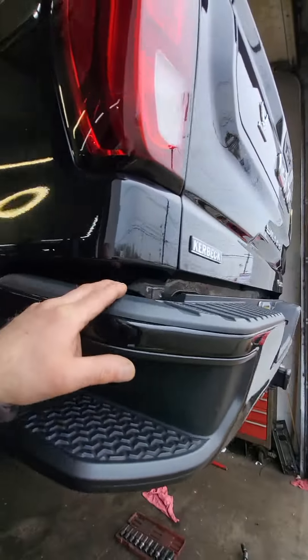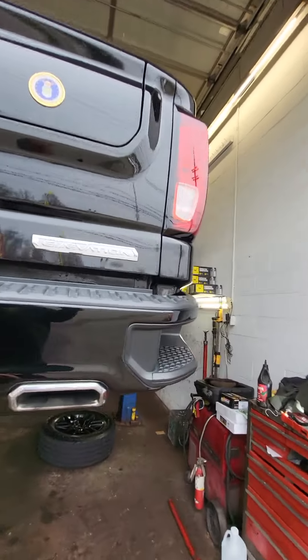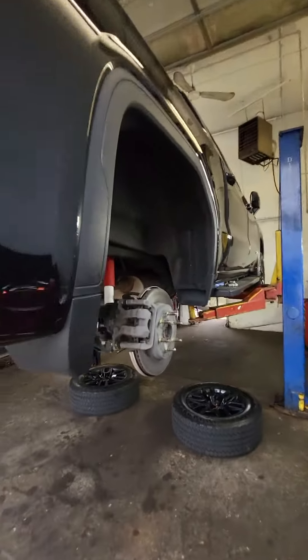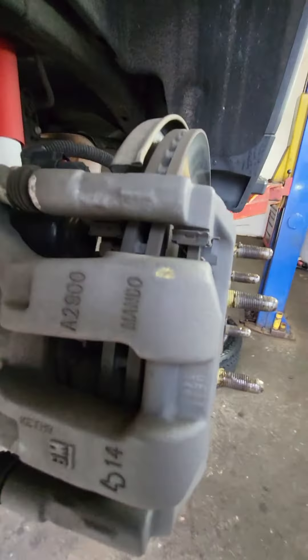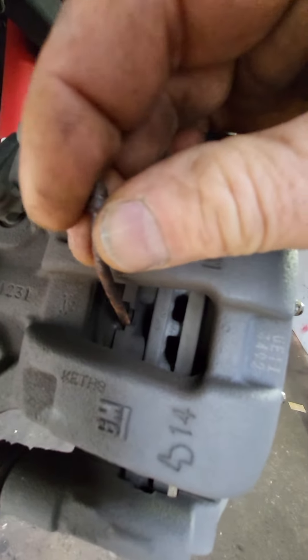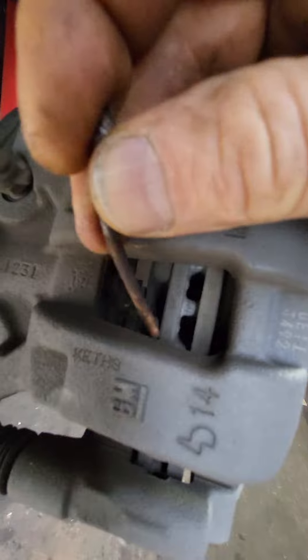What he did ask us to do is see if we can correct the gap in his rear bumper from somebody hitting it, so I'm going to take a look at that now. The customer did not need any brake work — zero. Here is the metal backing of the brake pad where the sensor would go, and here is the friction material remaining. That is not three millimeters — not on any wheel. Thanks for watching.